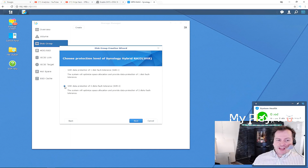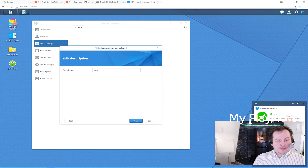This is a RAID setup. It's not a replacement for your backup in any sort. RAID does not mean backup. RAID means that you don't need your backup as much. It's a drag to have to restore from your backup, so you put RAID on your system to prevent having to do that as often. It's no replacement. Next.